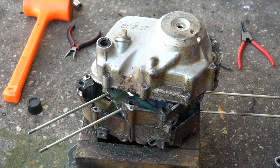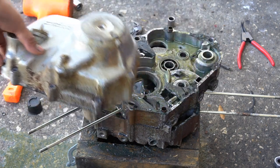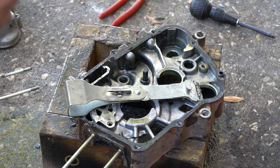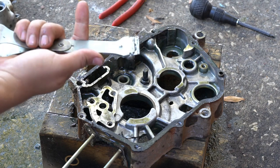I've got the horizontal engine totally broken down — all components cleaned and inspected. For the internal workings, I have left the clutch cover case and the two center cases. I'm going to show you what I do to get these cleaned up in a multi-step process and kind of how laborious it is to get them to the finish level you see in pictures of my finished projects. I've removed the seals and the transmission bearings. First stage: let's get the gaskets off — I'm going to use a scraper.